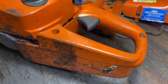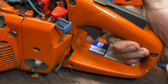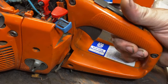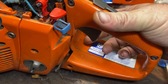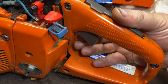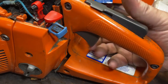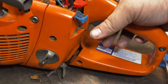Let's stand it up and give it a good test — make sure nothing's hanging. Make sure that the throttle doesn't engage when the lockout is up; that's the whole purpose. And ours doesn't, so we're good. Then mash your throttle — you want to mash it fast and slow if you're checking for hangups. I like to also mash my lockout, squeeze my trigger, release my lockout, then release my trigger. Do that several times and make sure it releases and catches where it's supposed to. If not, you may need to replace your trigger as well — there may be some wear on that contact point.